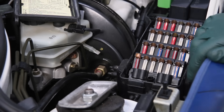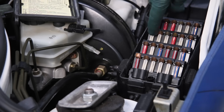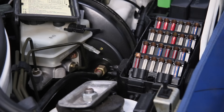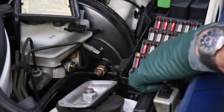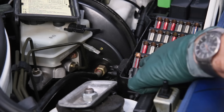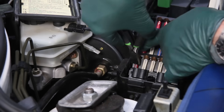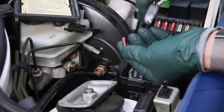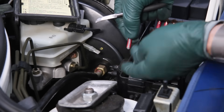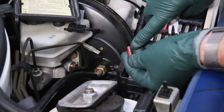While I'm wrapping this up, I also want to caution you about these old fuses. Look at these fuses — they're all corroded. You may have seen my other videos on fuse box upgrades, but you have to be real careful. You may look at a fuse and it looks okay initially, but get close and the head has fallen off. See this? The head's falling off, so it's not making contact. This is what happens with these old aluminum fuses — just get rid of them. They may look okay.